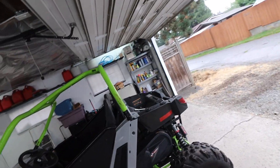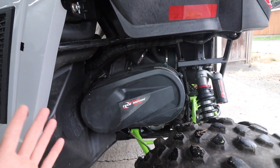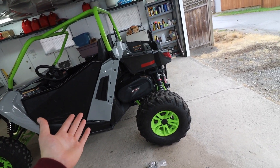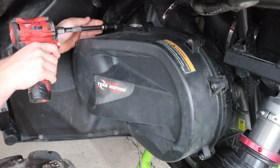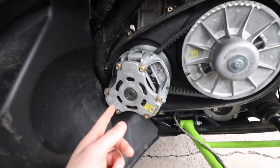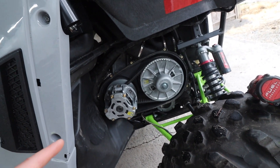First we're going to install the clutch. This isn't like a normal car where the clutch is between the motor and the transmission. This thing is called a CVT — it's on the side of the engine and the way that this one's set up, it's right there. So that's super easy. You're just going to take off all the bolts that go around here — I think there's about 10 — and then it exposes what we got to take out. This is the primary and this is the secondary clutch, and both are what we're going to be changing. The reason I'm changing them is to fix a factory flaw: the part gets hot, expands, doesn't have as much clearance, and starts to bind. This is going to hopefully fix it and it's also a stronger spring rate, which is going to make this thing drive a lot more smooth and responsive.